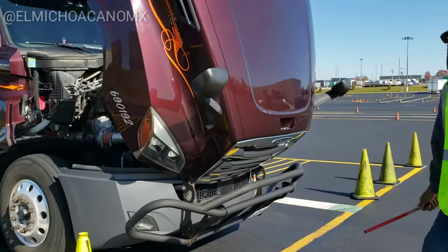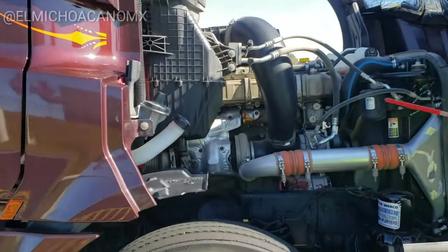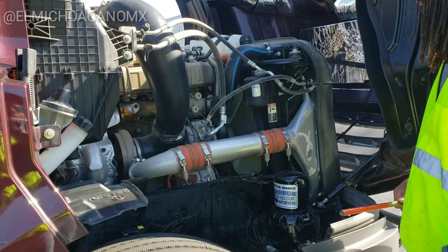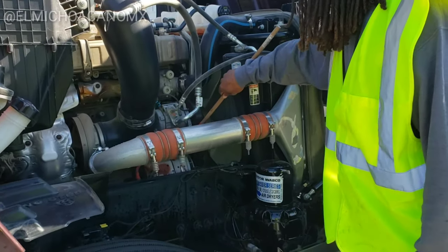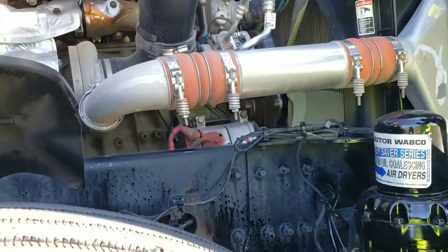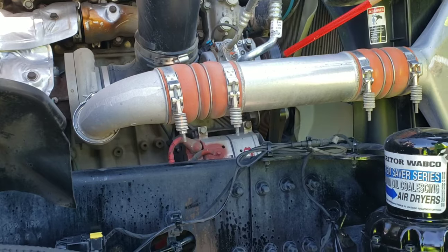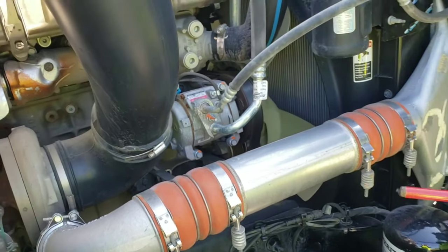Now I'm gonna move to my passenger side. All my general hoses are properly mounted and secured on both ends — no abrasions, bulges, or cuts, and they're not leaking. My belt-driven alternator is properly mounted and secured, not cracked, bent, or broken, and all my wires are connected. My belt is not cracked or frayed, and the free play is between half and three quarters of an inch.